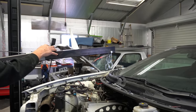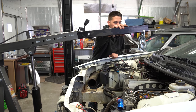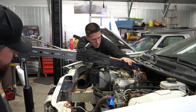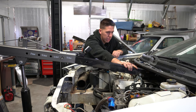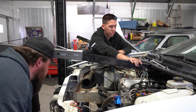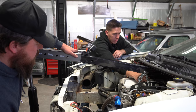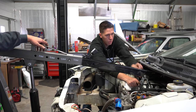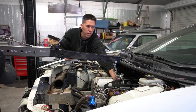That's as far forward as we can go and it looks like we're almost over the center hook. We should be good — let me bring the jack down a little bit. That ain't gonna work — we're going to have to go off the pole, try going off this one. Hopefully it doesn't let the engine rotate back too far. I can move this chain up where it's just the chain riding right here. Let's try that. There we go — that's the ticket.